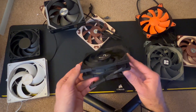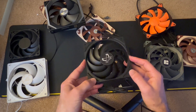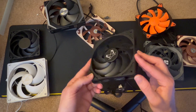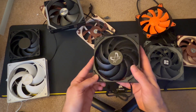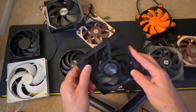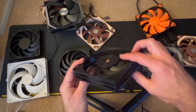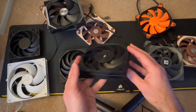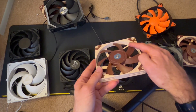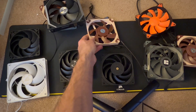The Wonder Snail blades are close but not insanely close — I'm not sure why this one is as noisy as it is, because it seems like it shouldn't be. The Thermal Right B12 tip is pretty close and doesn't slope that far down, which I think explains the noise there. And the slim Noctua — there just isn't space for Noctua to slope those blades down and in, so they are pretty close to the edge.